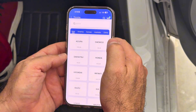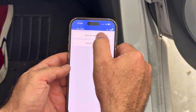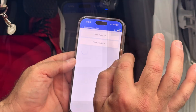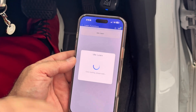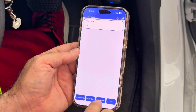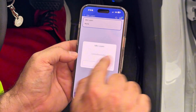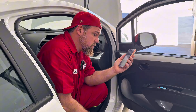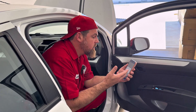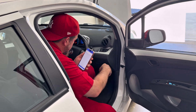Let's see what we can do with the throttle here in Australia on the Holden. Automatic detection — learn functions, idle learn. Learn successful. That means with this V-Diag D200, you can also perform the idle learn, oil resets, and these kinds of special functions.